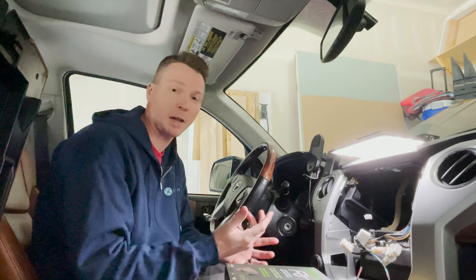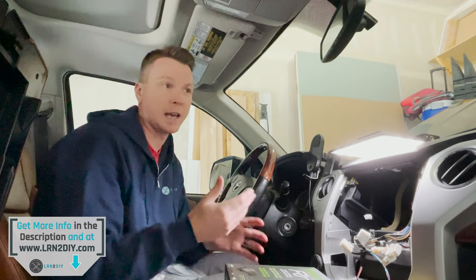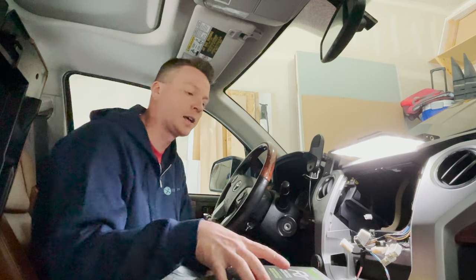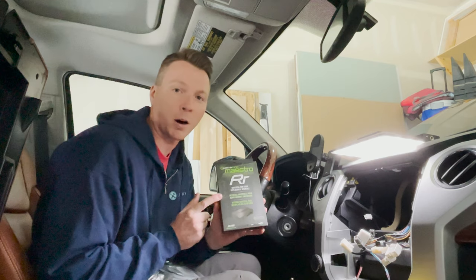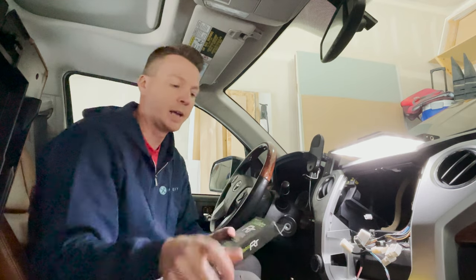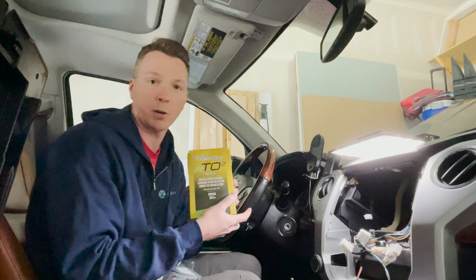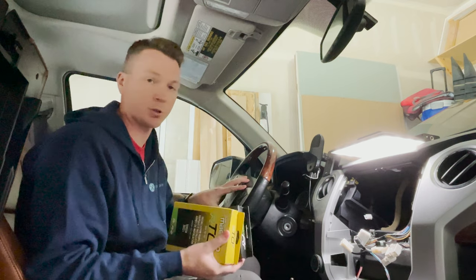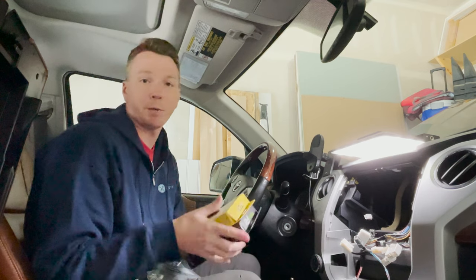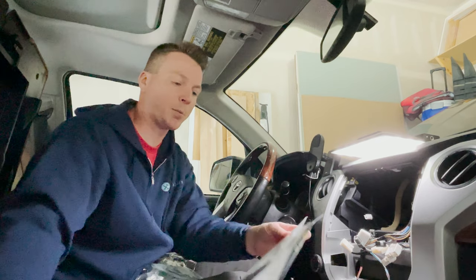With the old stereo out, we're ready to put the new one in place. Unfortunately it's not a simple plug-and-play, but there are some kits that will make your life a lot easier — be sure to check the links in the description below. For this one, we're going to use the iDataLink Maestro RR. This is basically a universal adapter that allows you to put an aftermarket stereo into your factory slot. And to make it specific for the Toyota Tundra 2014 and up, we've got the TO2 here, which makes your steering wheel controls work, connects with your cameras, and gives you speedometer info and more.